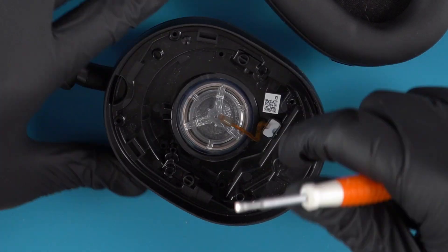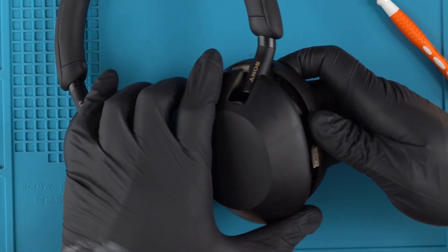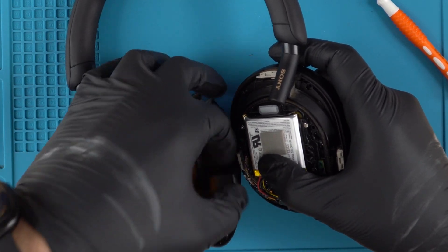With our flathead we're going to pry off this little rubber cover for the MS port, coming in underneath and prying it up off the speaker so that we don't tear it off when removing the speaker. Go ahead and flip the headphones over, pop the outside touch cover off, and unplug it — just pull it and it should disconnect from the power board.